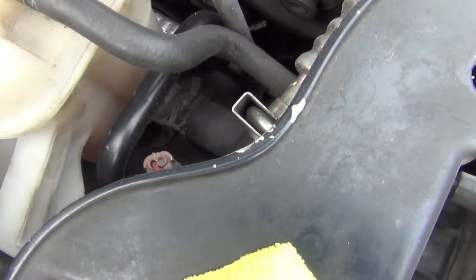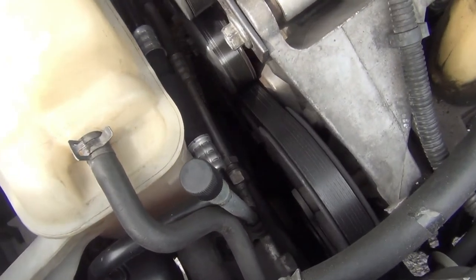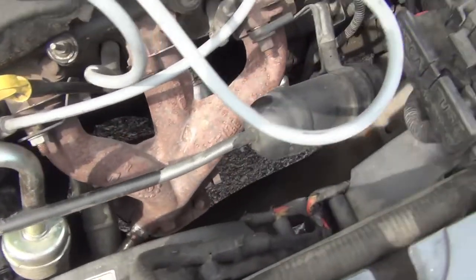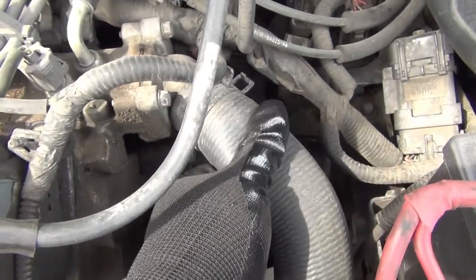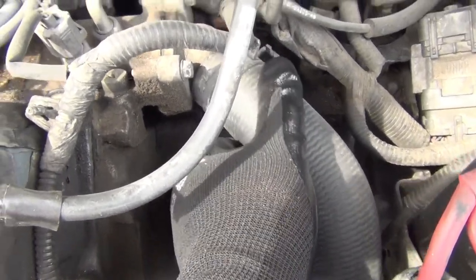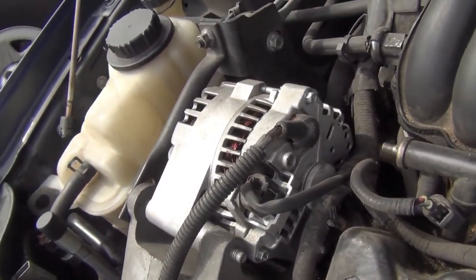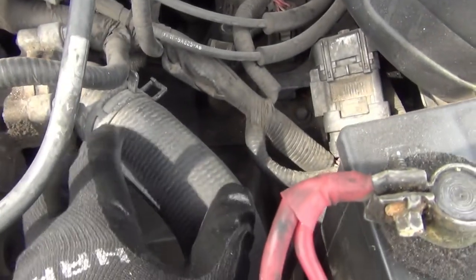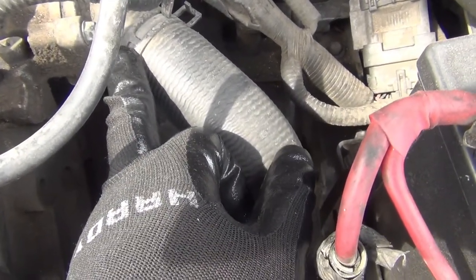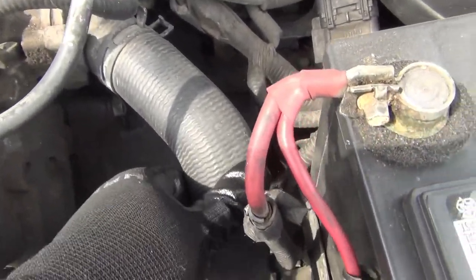If your system is not purged or burped right, I would just assume the best thing to do is to go back and redo it and make sure you get all the bubbles out. The best way I know is when you put your antifreeze back in your reservoir, keep the cap open and go around and start burping the system — keep pressing the hose. By doing that you can hear it from the reservoir, and you can see it coming up through the system. Do that for about 10 to 15 minutes, maybe 30 minutes, just to make sure you have all the air out of your system.